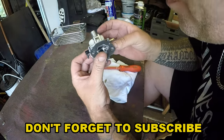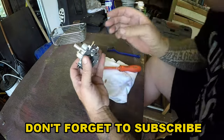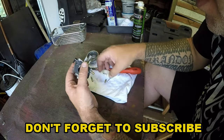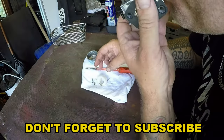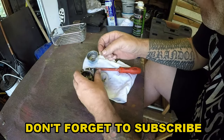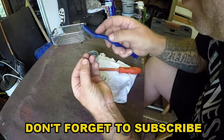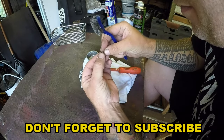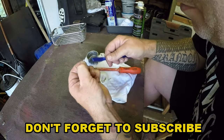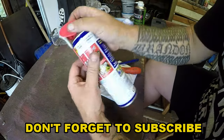That's not letting no fuel through. Nothing at all. So that's not good. That's working. Let's just give that a bit of a clean. Sometimes it is literally just the minute of stuff on these needles that won't allow it to lift. And I mean absolutely minute. Let's run some WD-40 through it.